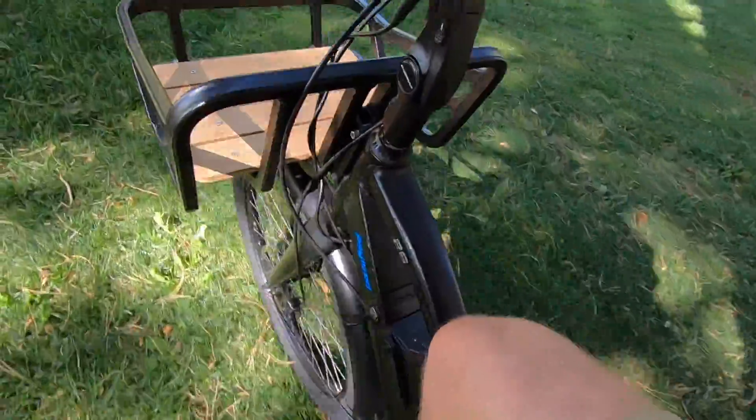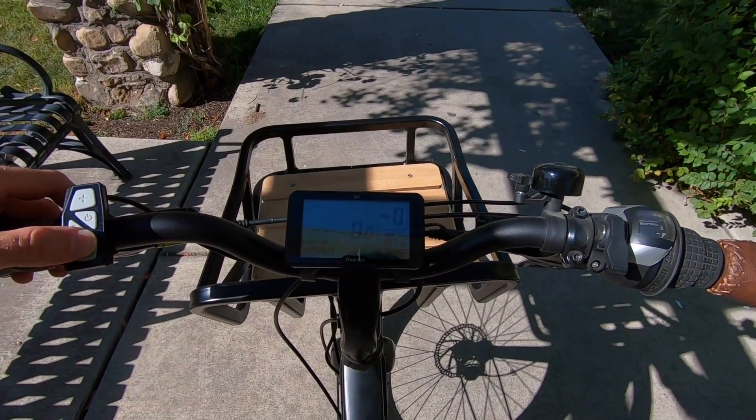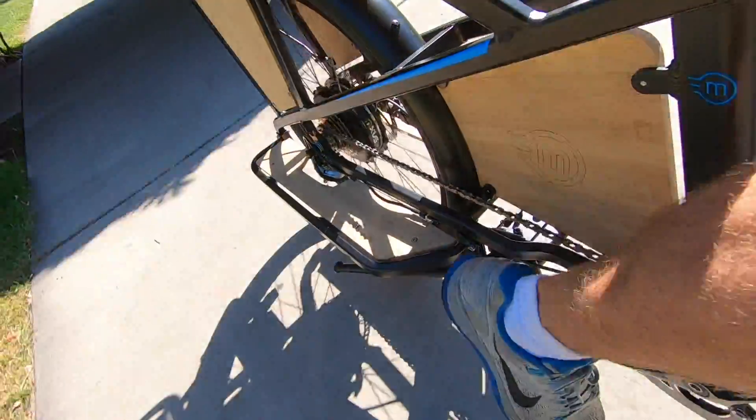I like those variable-speed throttles. It's pretty quiet out here. Those aluminum alloy fenders are about 70 millimeters wide, which gives you good coverage — they don't rattle around quite as much as plastic and they're not going to rust if they get scratched like steel would. Now I'm going to take it up to the top pedal assist level. By the way, it wraps around so you just go down from zero — boom, we're at six, and that's kind of handy. You can feel there's a little bit of delay just because it is a cadence sensor and it takes a minute to register.